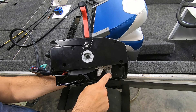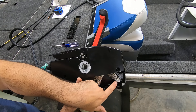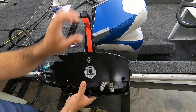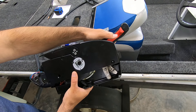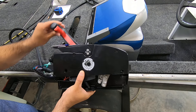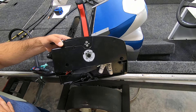All right, so here are the two points that your throttle cables connect to. If I push this out of neutral into forward, I can see that the front one is the one that moved — same thing if I change gears to reverse. So that is actually going to be where the shifting cable is attached. And if you'll notice, the second one moves when I adjust the power of the throttle. So you can see the difference between the two. We're going to get these both connected and then we'll be able to tell which part they go in on the motor.